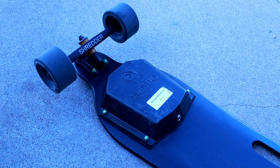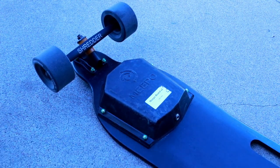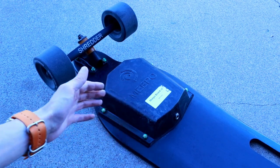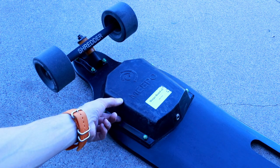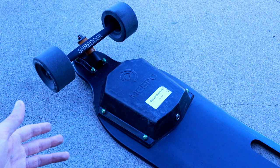Now the more serious problem occurs with the battery pack, which is also not insulated against water. If water penetrates this battery pack, it actually fills up this lower section of this housing like a bathtub if it's sitting right side up. And I actually had that happen without realizing it. This thing was about an inch deep in water after being ridden pretty hard in the rain, and I didn't have any issues with it reliability-wise until about 5 days later when it wouldn't charge anymore.